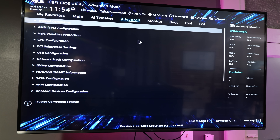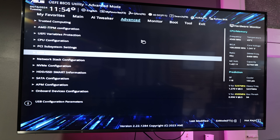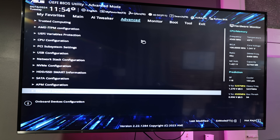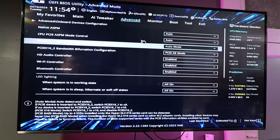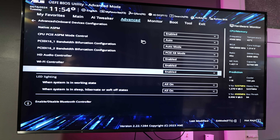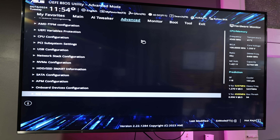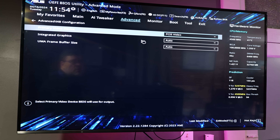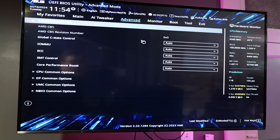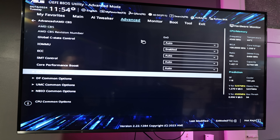Our BIOS here is a little out of date out of the box — no problem. Something you should get used to when doing a build like this is updating your BIOS. It's very straightforward on Asus boards. If your board doesn't post, you can use Asus BIOS Flashback to flash the latest BIOS, and chances are it will post after that — assuming you've checked the other common things like power connections and motherboard diagnostic LEDs. If all else fails, update your BIOS because that's probably it.